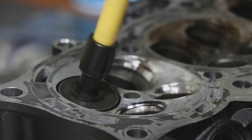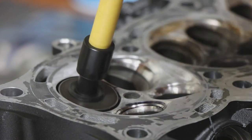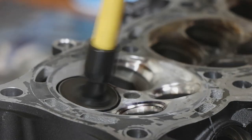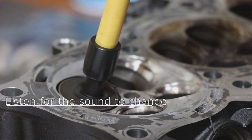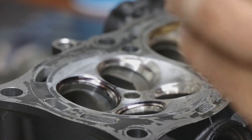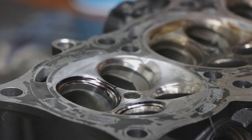How do we feel about lapping compound and coatings on titanium valves? We do not. I do not lap regular valves anymore. You know, this is what lapping would be if I had some sort of abrasive compound. There you go. So modern titanium valves do not get lapped in the traditional way using a lapping compound.